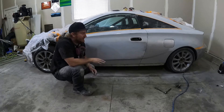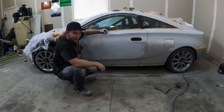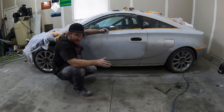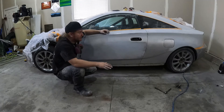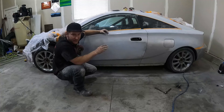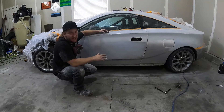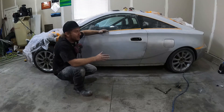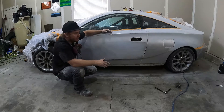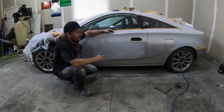Hopefully you haven't burned through yet. You might have noticed I left all my edges raw — that's because edges are your most likely area to burn through. So I usually jump in at 320 or even 400, depending how sharp the edge is. Since this one is nice and roundish, I'm going to save it for 320. Whereas around the wheel well — that sharp body line — I'm going to save that for 400. The reason is it's such a fine point; when your sandpaper goes across there it's going to cut way faster than any flat surface. Focus on the flats and areas that make the most sense, then wait until a later grit for areas that will shape up quickly.